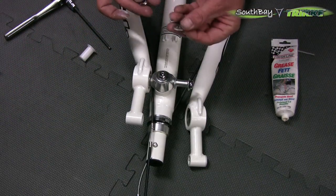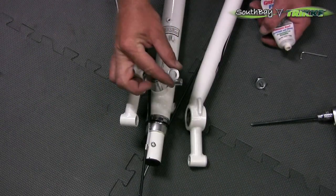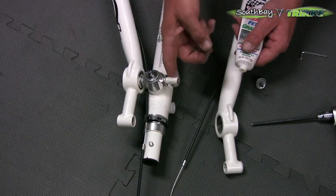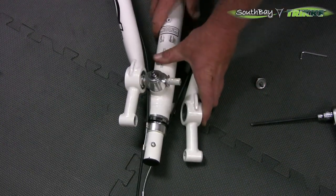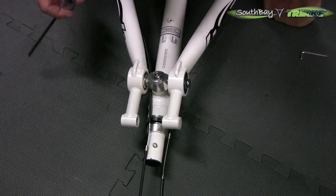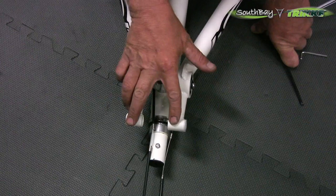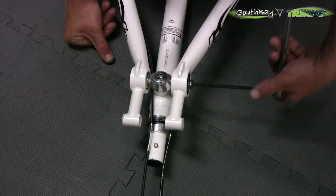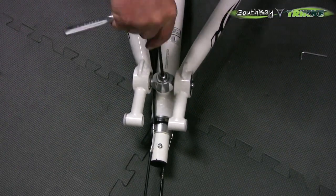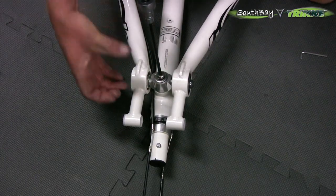Before you put it back together, put a little bit of juice on there, bolt back on, slide it in. Do the same to this side. This washer right here has got to stay on. We want protection on the back side of this bushing. Take a little bit of white grease — don't overdo it, just enough for a little lubrication. Grease just brings dirt into your system, you don't want that. Now that I've got both on, I'm going to go ahead and tighten them down — not all the way, just snug, because I want no issues when I go to put the axle in. I'm even going to back this bolt off a tad so the yoke can move back a little. This bolt will be the last thing I tighten — it'll pull everything tight.